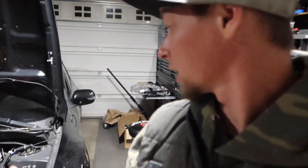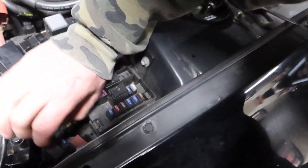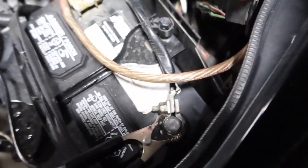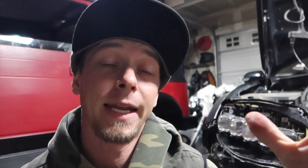One other thing you could do if you didn't want to replace that relay: you can actually clip the middle lead off, or you can go into this fuse box — there's a little tab on the side, you can take the whole thing out and de-pin it. Both relays pop right out and you can get to the bottom of them and de-pin whichever pin is the missing one on this module. It's about a ten dollar module for two of them.